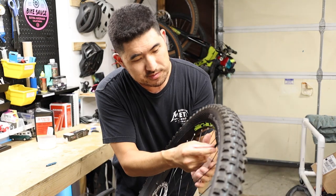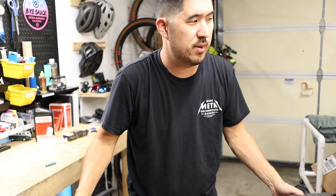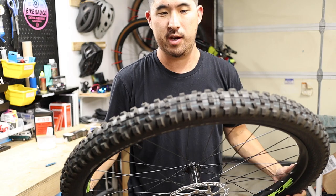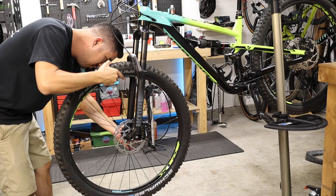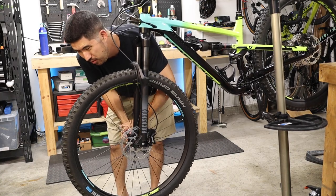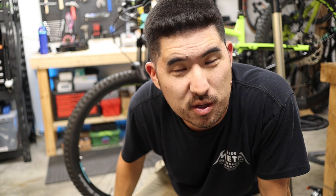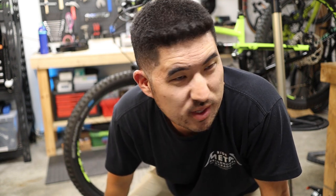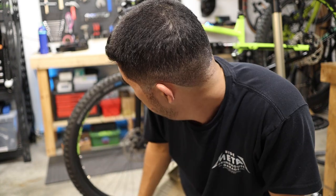You're actually done. All that's left is to reinstall your valve cap and you're ready to go. I would do this at least one day in advance — if in the morning you come out and your tire is still holding air, you're set. Put the wheel back in your fork; on this Recon we're aiming for anywhere between 9 and 13 newton meters on the thru axle. And that's it — tubeless setup on the Polygon Siskiu T7. Highly recommend it: it really improves ride feel, eliminates pinch flats, and seals up small punctures as you ride.